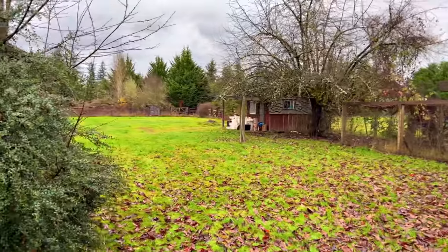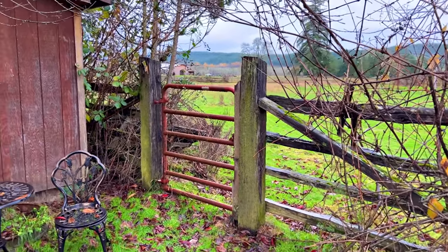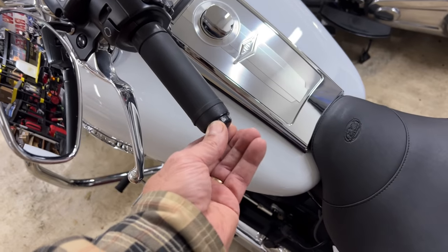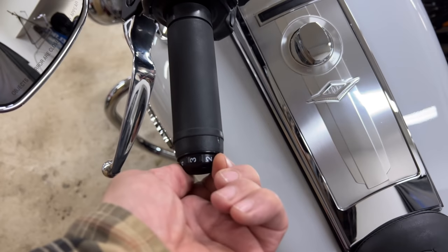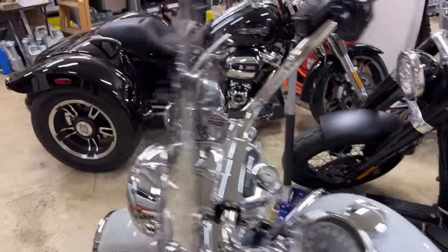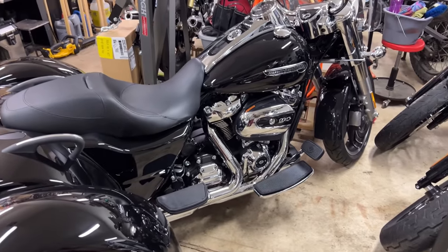We're gonna mess around with Flirty out here and see if we can make sure those grips will work. The grips at position six will draw 2.8 amps. I never go over two - I've turned it on three to get them going a couple times before, but beyond that there's literally never been a condition where I needed the grips that hot.